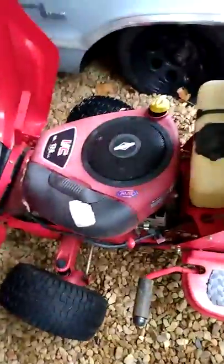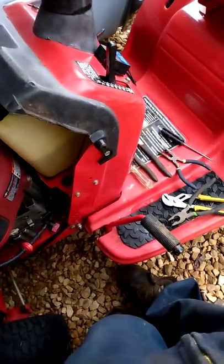Anyways, thank you guys for watching this video. I believe that this should take care of my issue. If you've got excessive slop in your clutch, and when you go uphill it starts to kind of back towards the tire and slow down, try adjusting that. Just go out there, and you've got to put it in seventh gear. Start it up. Let it run in neutral. That way it can ratio the belt to whatever ratio the seventh is. And then check your slop.